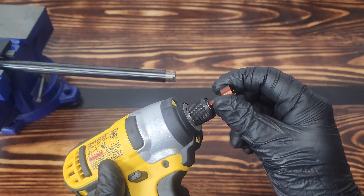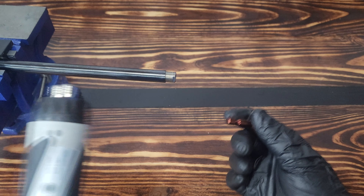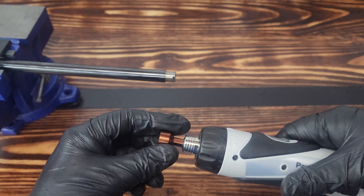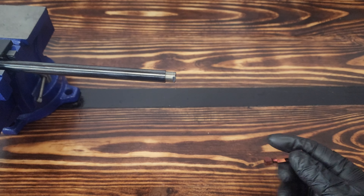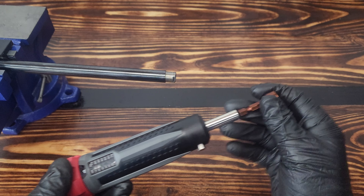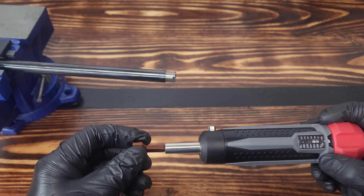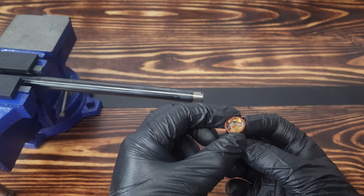This end right here is a quarter inch drive — this will fit in any normal quarter inch drive. Like I mentioned, my DeWalt driver goes right in just fine. If I want to put in my Panasonic tool here, same thing — chucks right in. Gives you some good wiggle room to accommodate a couple of different tools. And if I really want to get precise, I can use a torque driver that takes a quarter inch drive. It goes right in, it doesn't have to lock in — it's still a quarter inch drive.